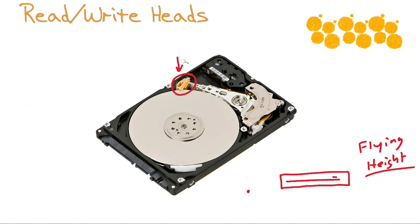What if the read/write head were to go to a wrong location on the disk surface? This is what we call disk corruption, and obviously it's a bad thing. What if the read/write head were actually to touch the platter? In hard drive engineering, this is called a head crash. If the read/write head touches the platter, it is extremely disastrous for the hard disk drive, typically resulting in a loss of data on that particular platter.